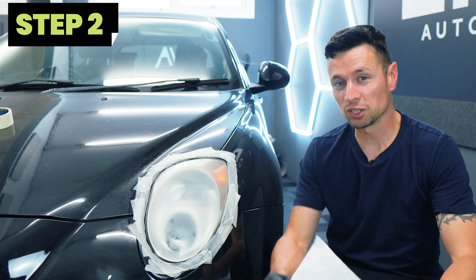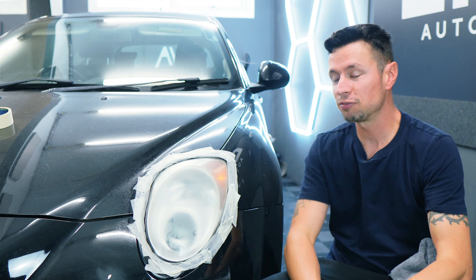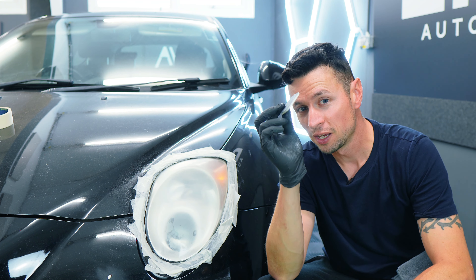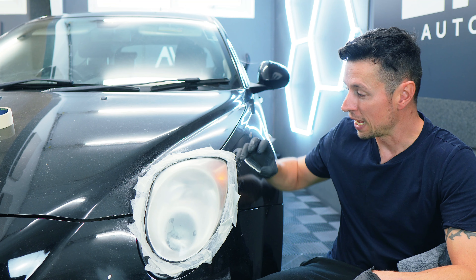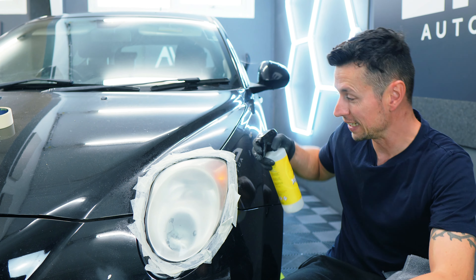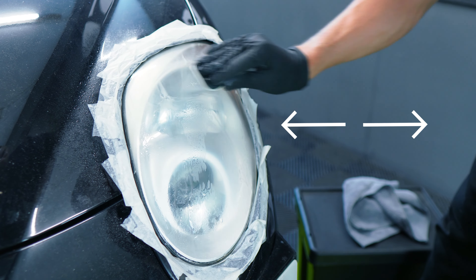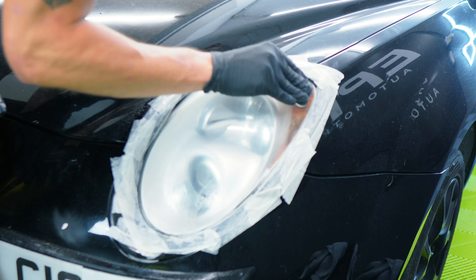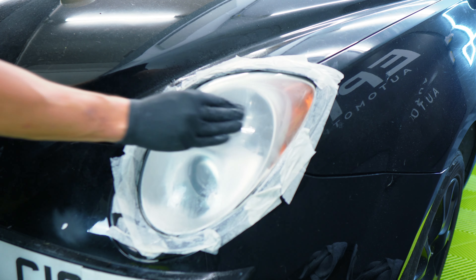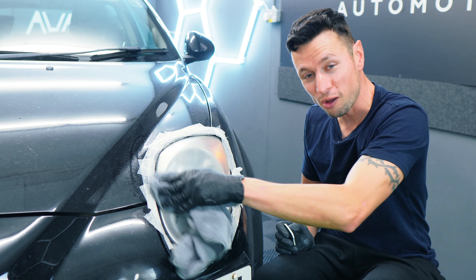Presuming you've followed the instructions and gone in a straight line up and down or left and right, you should have something like this. If we flip the same pad over, you'll see it's got number two on this side. We face side two downwards and go in the opposite motion to what we've just done. We spray the lights again with a bit more water and get cracking. The reason for sanding in a crisscross pattern is to ensure even surface wear, smooth out scratches from all angles, and prevent grooves — helping you achieve a clearer, more polished finish. At this point, it's still not going to look great, so do not panic. This is just part of the process — you have to make a mess to clean a mess.